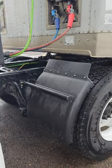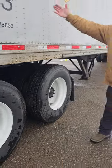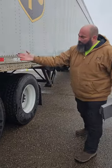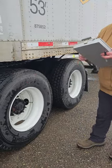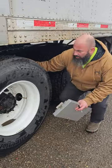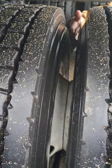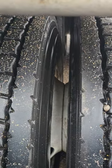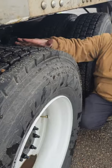My rear axle. What I do to this side, I will do to that side. What I do to this axle, I will do to this axle. And what I do to this tire, I will do to all tires. My tires, on the inside, they're properly mounted, properly secured to my rim. There's no cuts or bulges. And along the top, it's evenly worn, and there should be no less than 2/32 of tread depth on it.